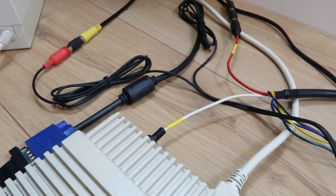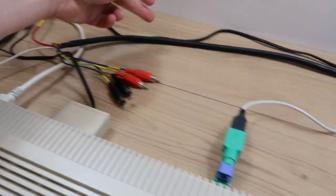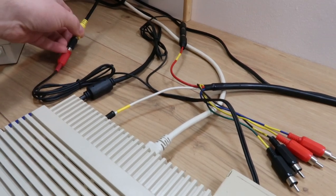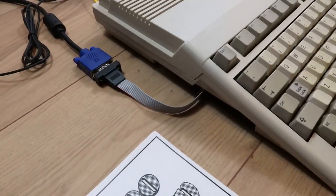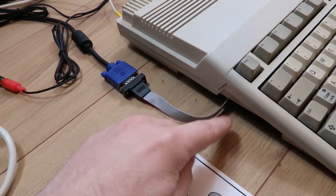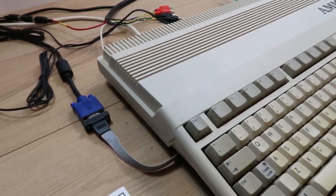It's also a good way to monitor the output from the Amiga, because that basically is a loop-back all the way through to here of what's coming out of the composite output on the Amiga. As a side note, I'm using an Individual Computers Indivision ECS to get the video signal from the Amiga onto a standard VGA monitor, so this is nothing to do with the VBS system itself.